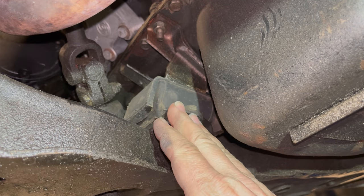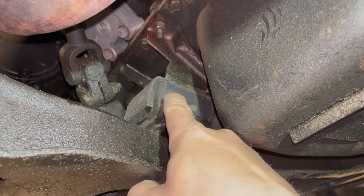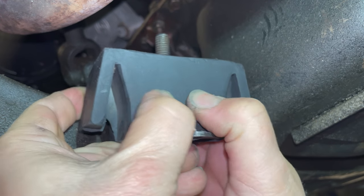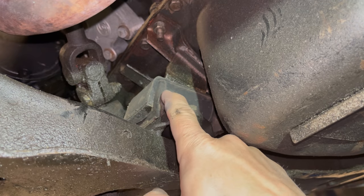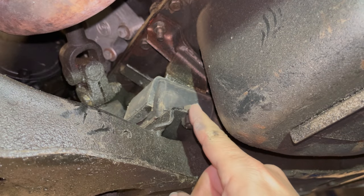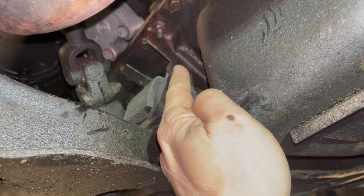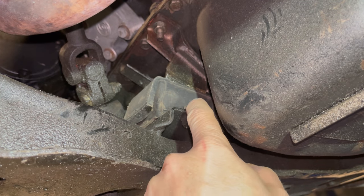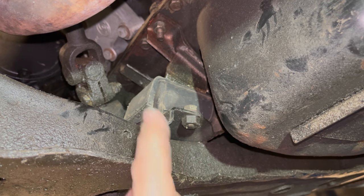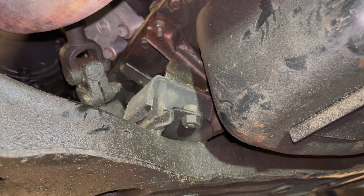Here we are on the left side of the car, kind of underneath the left side of the engine. You can see this motor mount here is compressed a bit, and it's actually kind of soft. Here's the new motor mount — this is very hard rubber; I can't even push into this. So I'm going to need to replace this one as well. As you can see from the bracket, it has two holes in it which go right here, and then it has a bolt which connects to the engine. There will be a nut up in that cavity that I'll have to undo. I've got my jack under the front of the engine and I'm going to crank it up to relieve some of this weight — it'll make it easier to get that mount undone.